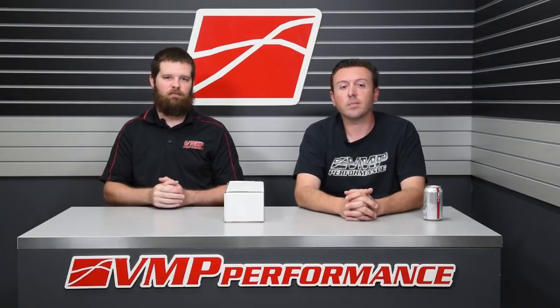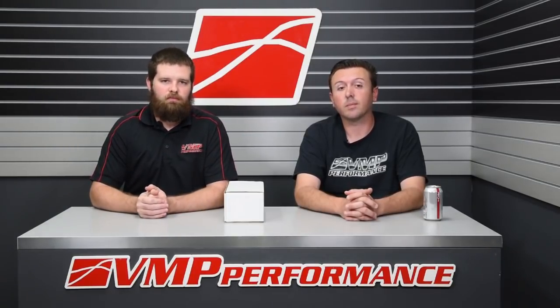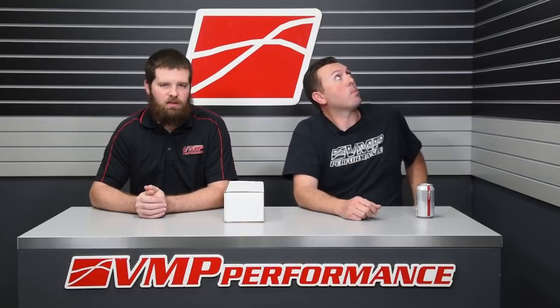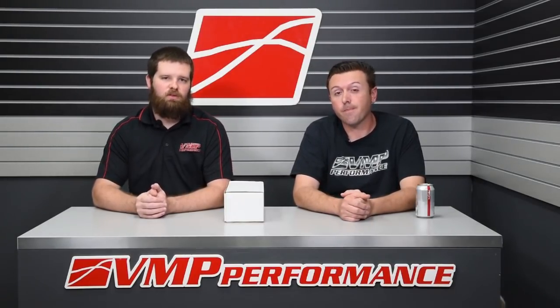Wesley says, I have a 16 F-150 4-door bone stock. Could I get some horsepower gains, and possibly how much? Yeah, the gains and how much depend on your fuel quality and what exactly we're doing as far as mods on the truck. I'd say a good first mod for the 15-17 trucks is a cold air. You don't need a tune update for a cold air on a 15-17 truck. And to clarify, by 15-17 I don't mean year 15-17, I mean 2015 to 2017.